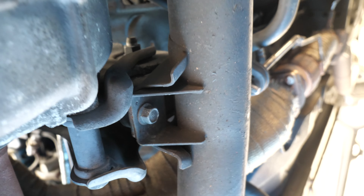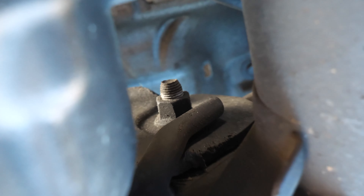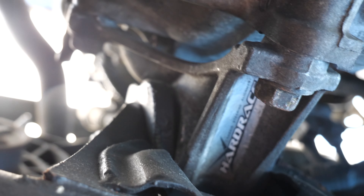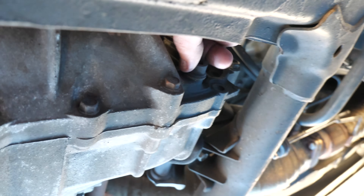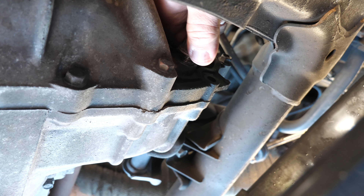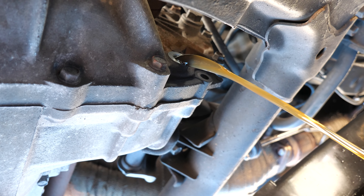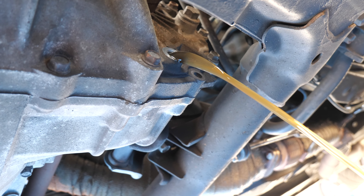So the reason we've been vibrating our absolute nuts off is because we've got hard race inserts in the engine mount. You can see through there. I might swap those out — it's just uncomfortable. It's alright when you're sending it but not on the road. Gearbox fluid capacity is just under 2 litres — Scott says around 1.74 litres, sounds about right.